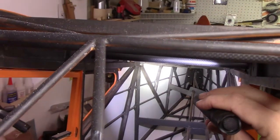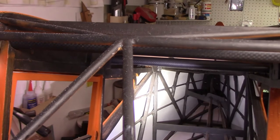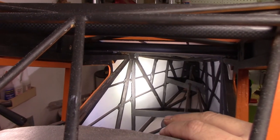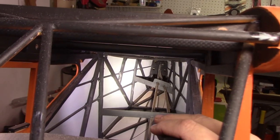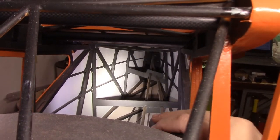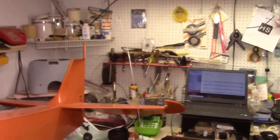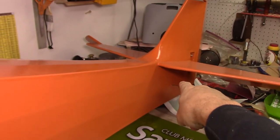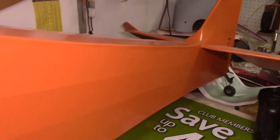Let me show you what I had to battle with. I had to come underneath all that stuff, and with the framework on the side being stood off from the stringers, it kept sliding behind it on the side and down on the bottom. It took me probably about a half hour just to get those two lines run down pretty decent. Then I had to come back in and work with a couple little twists where it went underneath or over the top. What I used was just a piece of 60-thousandths wire with a little hook on it. Because the tubes are so tight to that cable, I couldn't do anything else. I knew it was going to be tough — I just really didn't think it was going to be that tough.